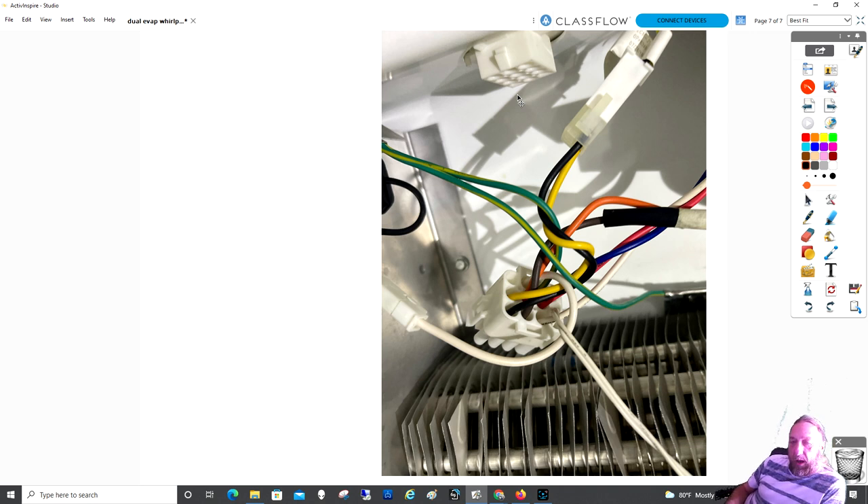So going back — why was the refrigerator compartment frosted up? We had two different problems: a frosted refrigerator compartment and no cooling in the freezer. By having that quick disconnect disconnected, we were disconnecting not only fan motors and defrost components in the freezer, but also thermistors and controls. These two white wires right here are your thermistor wires, and the control board can't see them, so it has no clue what's going on.